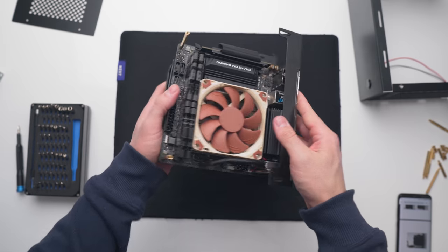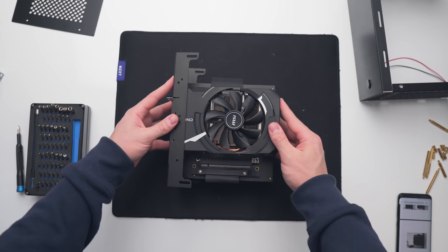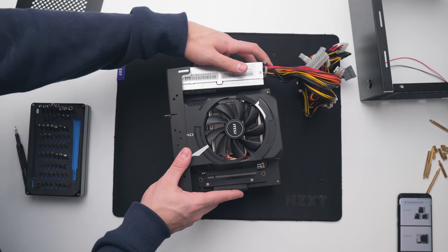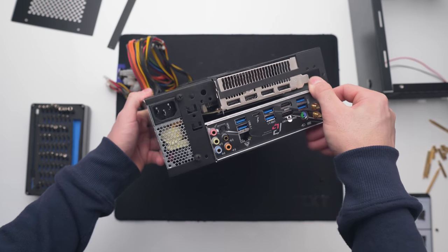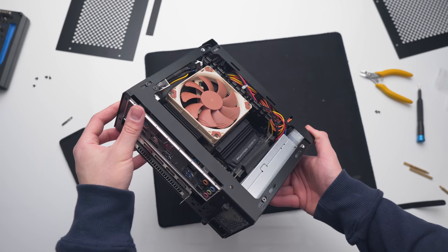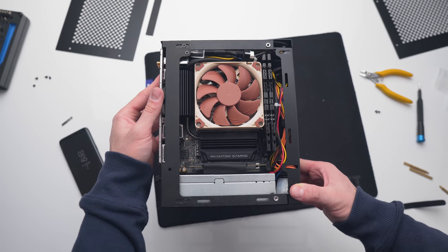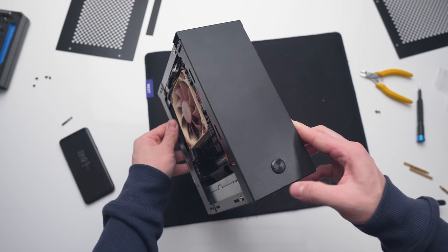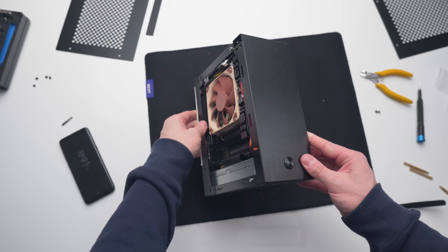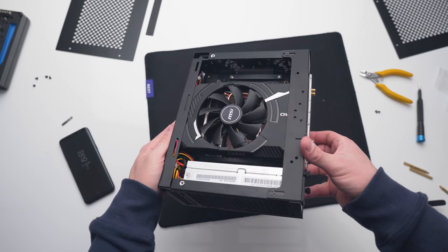You'll also want to screw the motherboard standoffs to the frame to temporarily hold it in, otherwise it'll feel like your motherboard and GPU are just floating. The next and hardest step is installing the power supply and routing the cables. The Flex ATX unit slots in pretty comfortably at the bottom and secures with two screws, but the cable management to follow will take some time. If you don't mind cables in plain sight then just slide the final panel on and you're good to go. Otherwise, it's a good idea to spend the next 15 minutes or so using the included Velcro ties to manage things a little better. I managed to get my Velka 3 build to the point where most of the cables were bunched up directly between the power supply and the front panel so that they weren't exposed in the rest of the build.